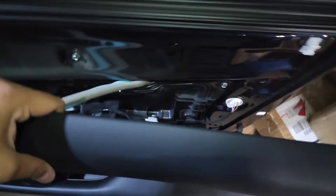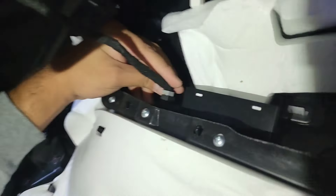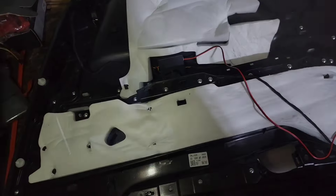Once you're here, lift it up. There's a clip here — never pull it outward, just push it up and then pull it out. The door handle assembly comes away by itself. You'll see clips with a little notch — press it and pull it down, same for this side, press it and pull it out. Your door panel is now completely released.